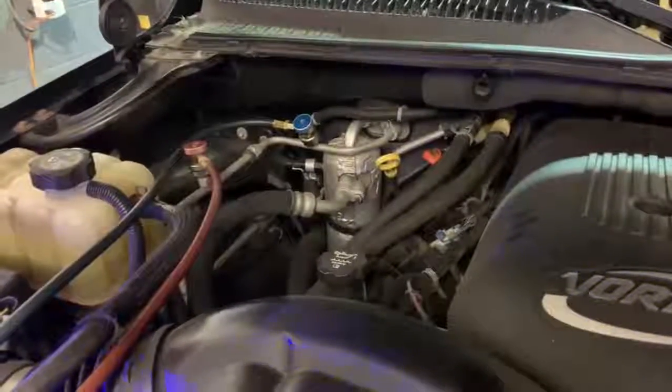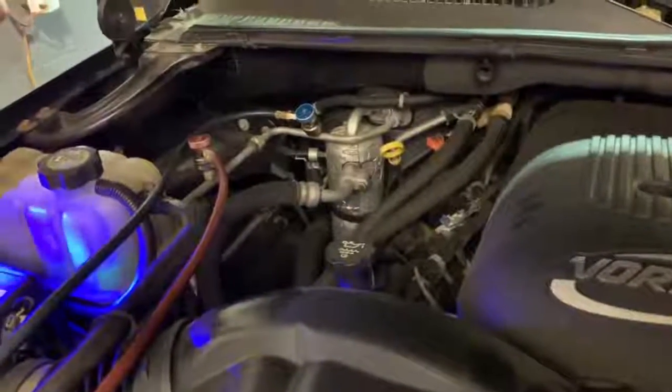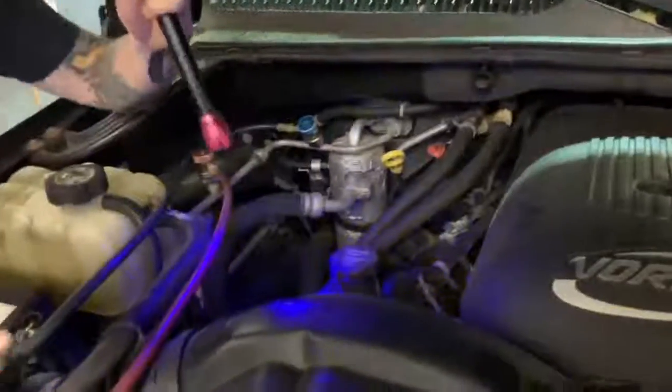You would look at the compressor. Vehicles like this that have rear AC, you would look at the line underneath. Thanks to the magic of TV, I have actually found the leak. And I take the camera, you can see, all right, so let's do this first. See if we can get this thing to focus. We can see we got the black light on there. We're not really seeing anything. But if we come down here to the compressor, you can see, if I can hold everything at once. There we go. If you look, you can see it's glowing. That's where the dye has leaked out.